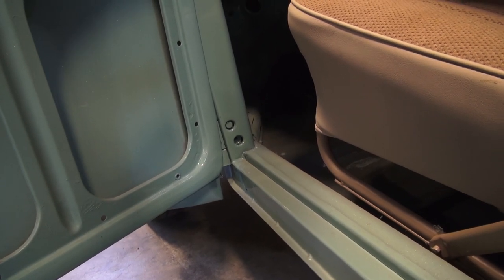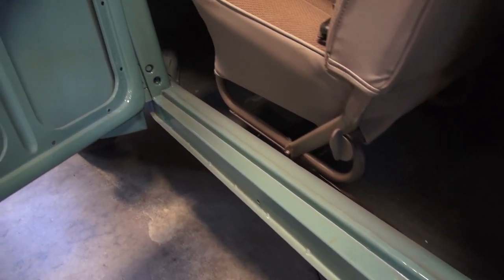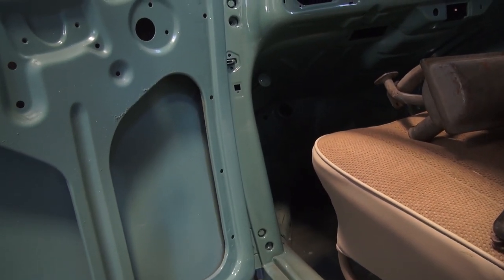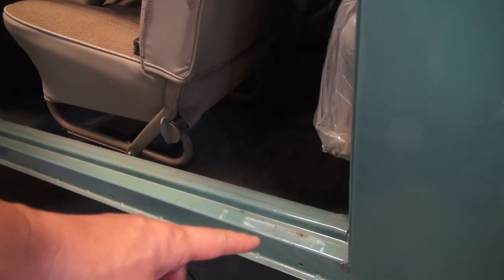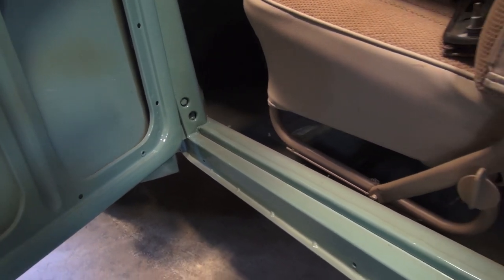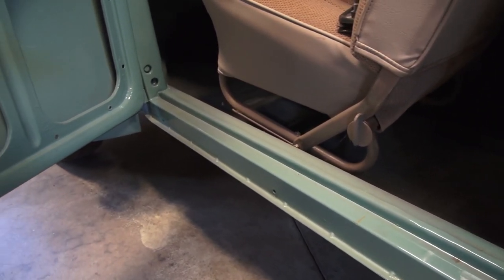You have to be mindful. If you are doing heater channels, I definitely recommend picking up the Bug Me Video DVD series on heater channel replacement. It shows you how to brace the car and make sure your doors align correctly before you start welding up brand new heater channels. Brand new heater channels today are kind of problematic — they're not year-specific, and for earlier bugs the shape is not always correct, so your body shop does have to do a little more work to get it right.